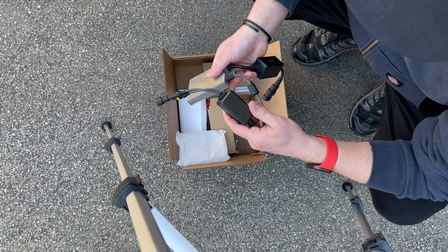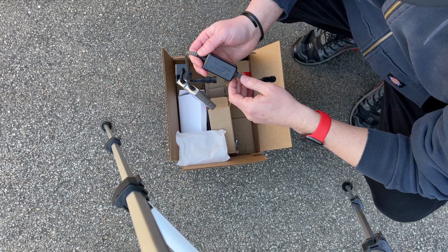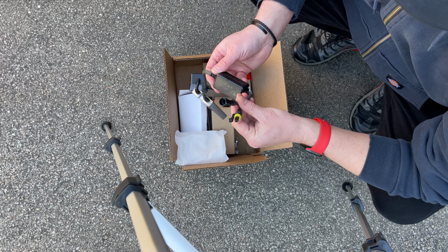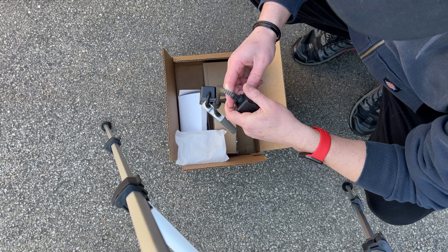This is the igniter. It says high voltage, caution, 380 volts, and it peaks at 23,000. Good little zap. And that's the whole thing for that, the initial ignition of the HID, because there's a gas. You can't just put in a low constant power to it. It's got to be a quick zap to get it going, and then it slowly warms up. And that's what this is. So then this guy right here is just the wires that go to the HID itself.